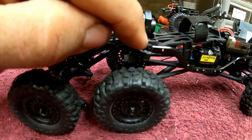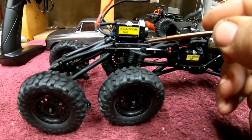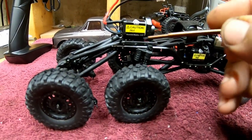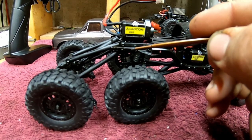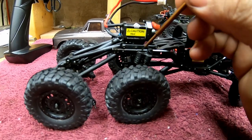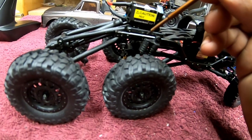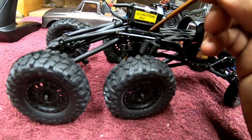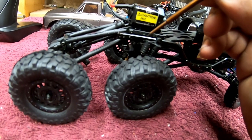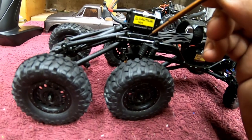The shock screw is going to go through the frame into, let me get a pointer here, this existing hole. This hole right here, we're going to punch a new hole, or not, sorry, wrong hole. There's a hole hiding behind the shock here. There you go. You can see it right there. Once this is in there, we're going to run a drill bit through there to punch a new hole in the plastic so we can put a screw there. So that way we'll have 1, 2 holding it in to be secure.